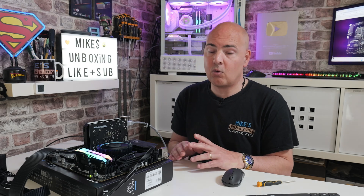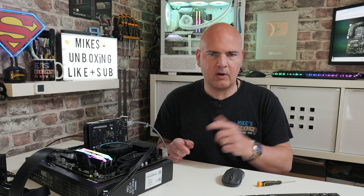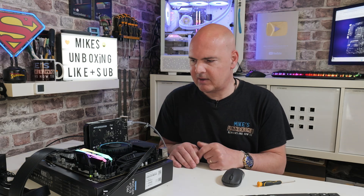So with all that said, let's head over to the computer and download the BIOS. You will need a USB drive for this, ideally 32 gigabytes or less. You need to format the drive as FAT32 file system. If you've got a larger drive, you can always create a smaller partition — we've done videos on that which we'll try and link in the video description. We'll also put links in the video description for a direct link to the MSI website to get the BIOS.